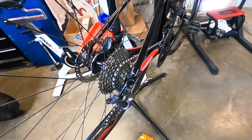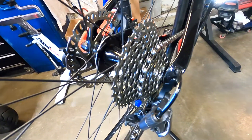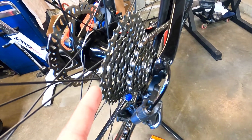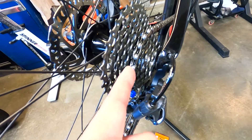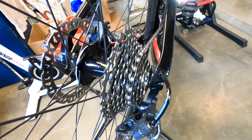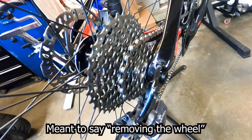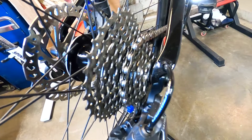I know they say this in their video, but I'm just going to say it here as well. You need to be in your middle cog. I'm an 11-speed and I'm on my fifth cog. I think you can be between five and six — it doesn't matter too much, but you do have to be in the middle cog. Usually when we're removing chains without this device, you would have to be on the smallest gear. But yeah, that's one thing to note.